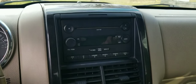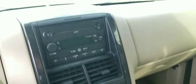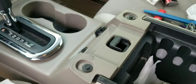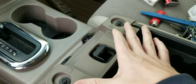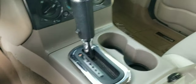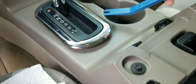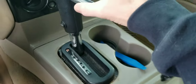Something's wrong with the stereo or the speakers — only one speaker works, and I believe the one in the back on the same side. To get this going, we're going to remove the trim around the shifter inside the center console. There are two 7-millimeter bolt screws — you're going to pull those out and keep track of them. Then we start prying this up; it's got clips all the way through — two clips in the back. If you invest in some of these pry tools, you can go inside and pop those. There are two more clips down here on each side. I've already popped it loose, but you'll use your tool to pop this off. Take the ring off and set it to the side.